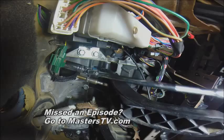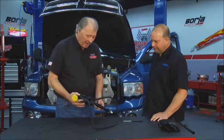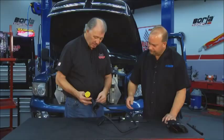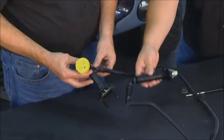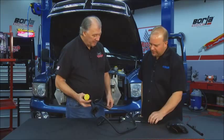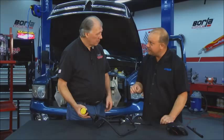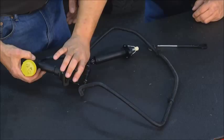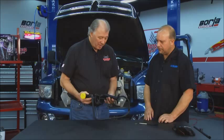Here's what we're going to replace what Sam just took out. Chris, tell me about this. This is the whole system — that's correct. This is a complete pre-bled hydraulic system. It includes the master cylinder, the connecting line, and the slave cylinder, with your reservoir up top. What we've seen over the last several years is a migration toward folks wanting to replace pre-bled systems rather than doing an individual slave or master. It cuts the time down from an hour and fifteen minutes to as little as fifteen minutes. A couple of bolts under the firewall, snap into position, another bolt onto the side of the transmission, and you're done. You don't have to worry about bleeding it or anything like that — this is definitely the way to go.